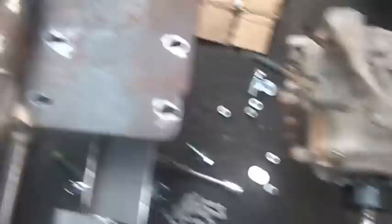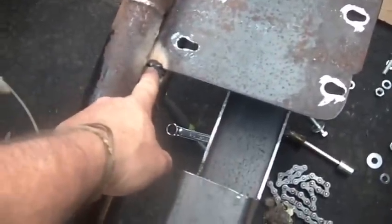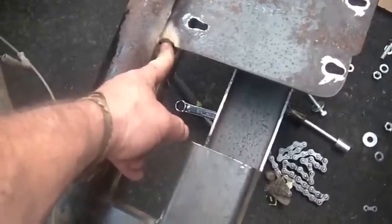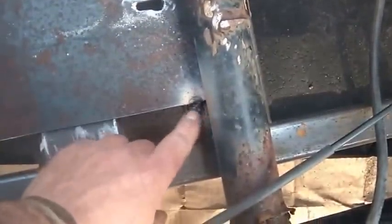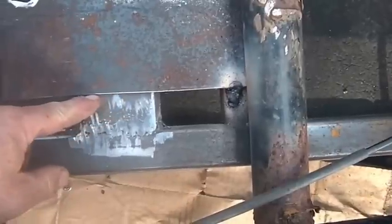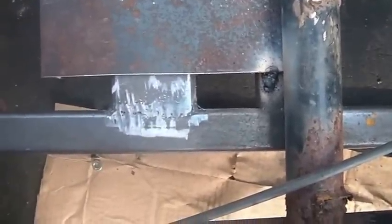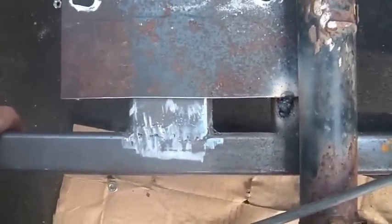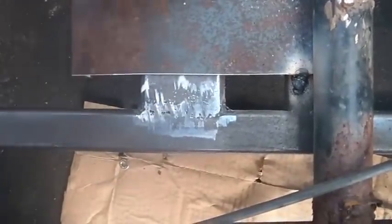I was able to reach in front of the engine and put these tack welds on here. It's kind of bubble gum — it's not a great weld in any way, manner or form. I put one on the other side also because I wanted the plate to kind of stay put. Now I can weld it rigid — put a nice bead across here. I think I'm going to take the frame out one more time and weld all of this up properly. I might trim this back and put a weld along the front.